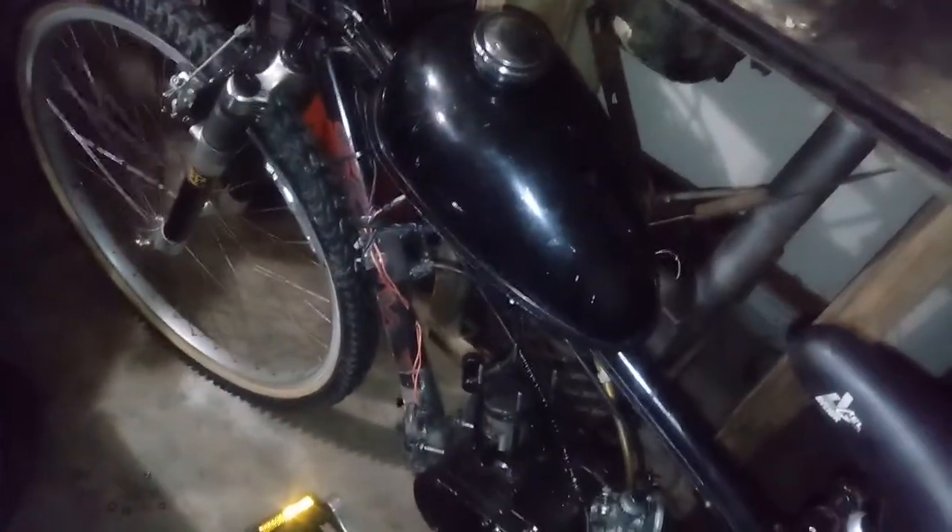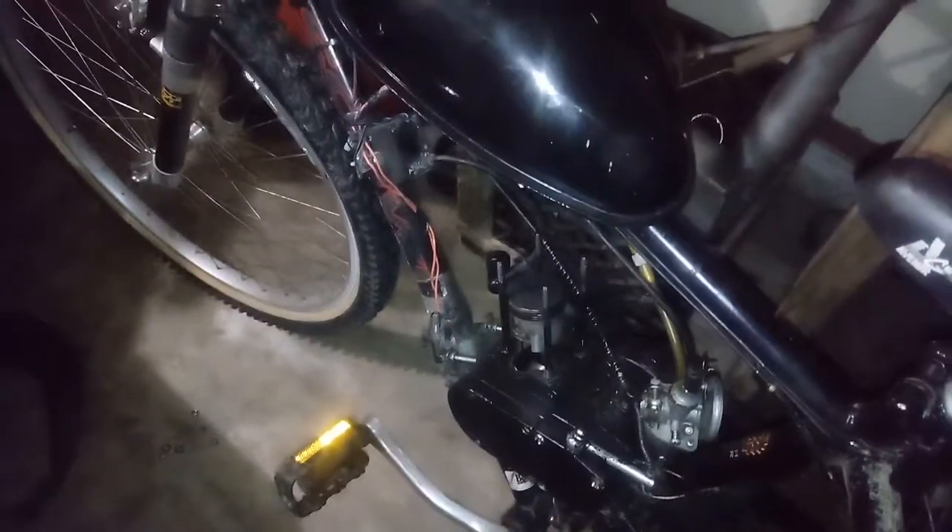I'm just going to go ahead and put this back together and see what the effect is. I also trimmed the gasket — it was sticking out in the port there where the air goes into the port. And that's about it for the mods this time.